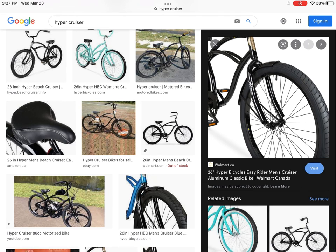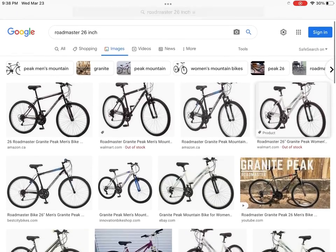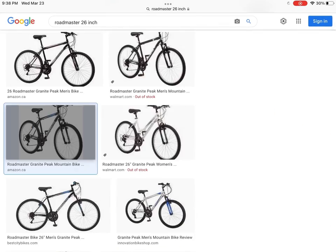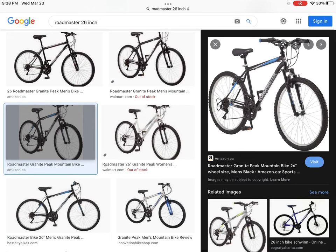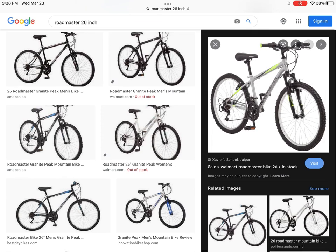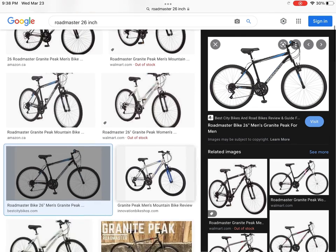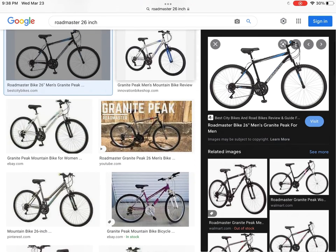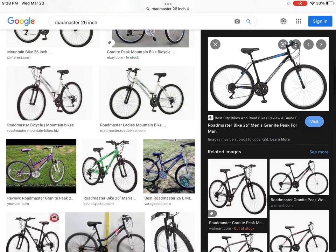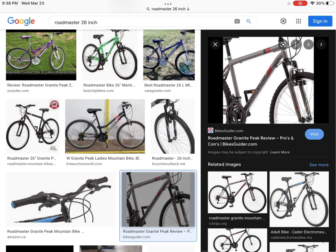The fenders on this bike are a little bit sketchy, and it does come with a coaster brake which has plenty of stopping power. Here's another option if you want to go the cheap route — this frame usually goes for around $100, probably $120 now with COVID. It's a Roadmaster Granite Peak, and this frame is known to be really durable for an engine. It's a little tight, so if you have a YD-100 with a spark plug that's forced to stick out the front it might not work as easily. But for any standard PK-80 engine or a two-piece cylinder design, it's going to work awesome. It has front suspension and a steel frame along with gears to make it easier to pedal.